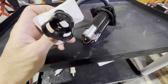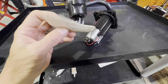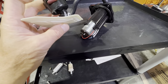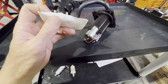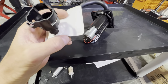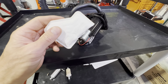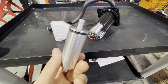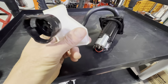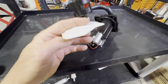As far as a filter goes, you have a nice big sock. Hondas do this — all Japanese bikes tend to do this — and it sits in the bottom of the tank. I carefully observed that this sock touches the bottom, because the goal is to suck up as much of the lower fuel in the bottom of the fuel cell as possible. Fuel is drawn through this mesh filter, which is a serviceable replaceable filter. The surface area of this is really similar to what we've got in the Takamoto filter. I think this is easily a 200-hour service life filter.